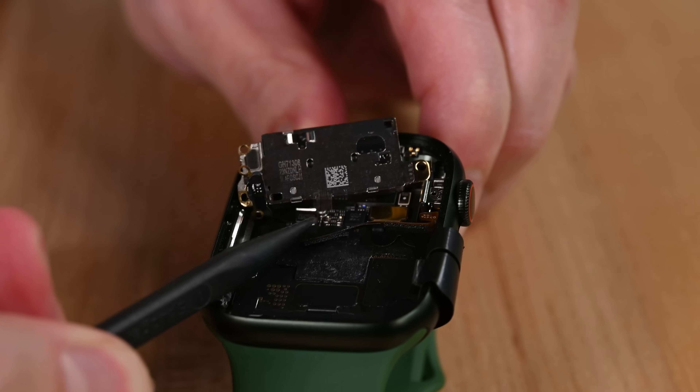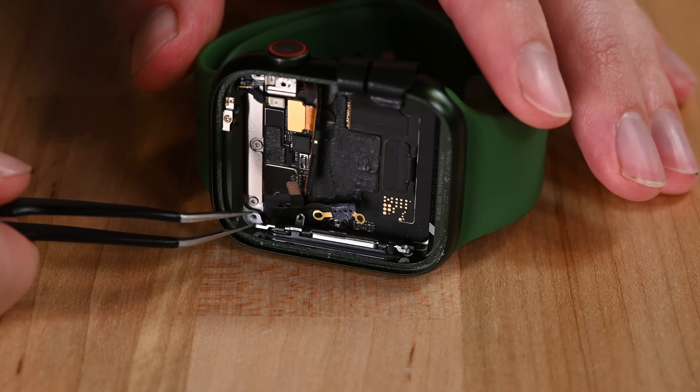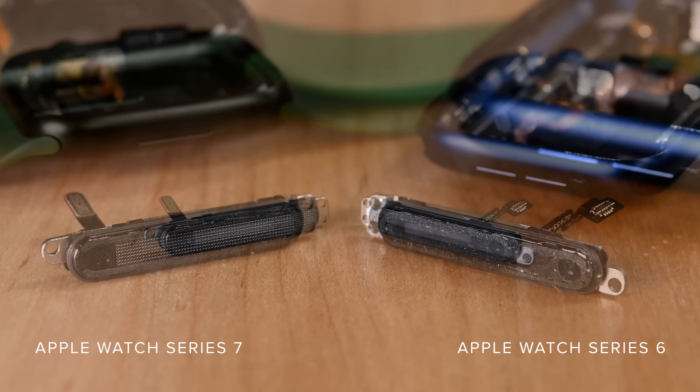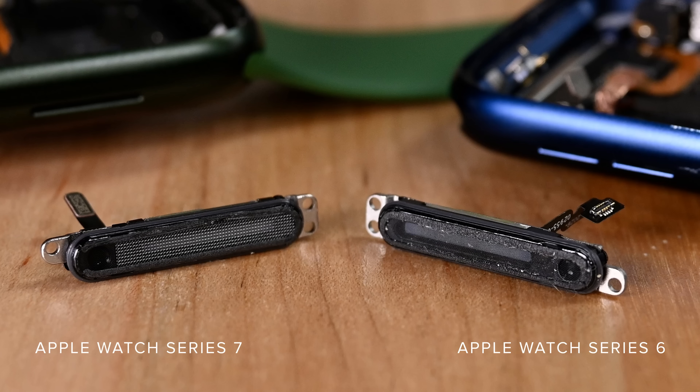Beyond the battery, the changes are small but impactful. Pulling the taptic engine and speakers out requires less fiddling with tiny brackets, and in general the team took time to rethink how everything fits together. Notably, the speaker mesh is quite different from the Series 6 — the old mesh looks tighter, like it would be more resistant to dust ingress, but the opposite is supposed to be true. When it comes to ingress protection, it's really the water seal tests that drive the design and are the harshest tests for these devices. Because they're orders of magnitude more difficult to water seal than dust seal, that's the deciding factor in most design decisions. The changes to the speaker and the dust rating may just be updates to how they document this, and not actually signify any serious design changes.